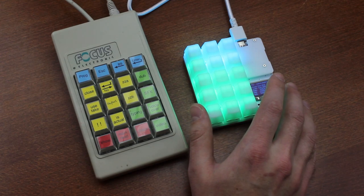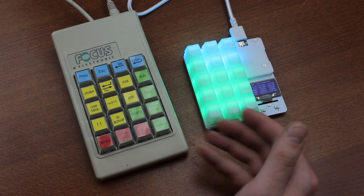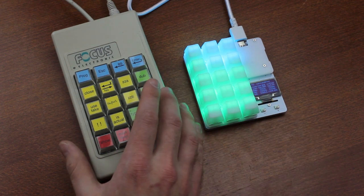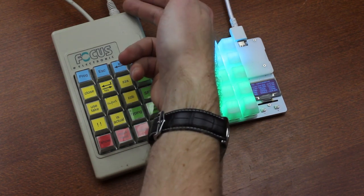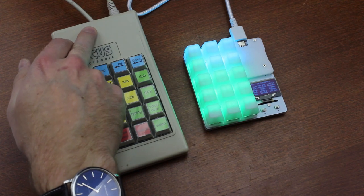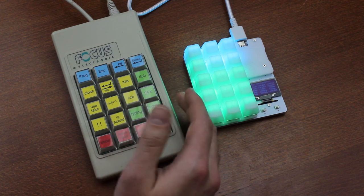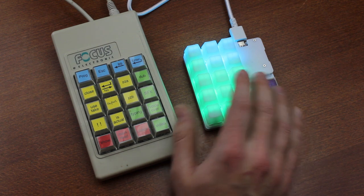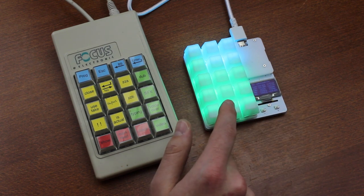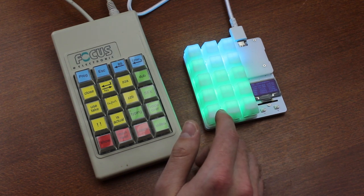On-the-fly recording is usually harder to arrange for macro pads anyway because they don't have the buttons you want to assign to the keys in the first place. The way old macro pads got around this was to provide a keyboard port — you'd plug the keyboard into the macro pad and then plug the pad into the computer, so the pad could record the inputs from the keyboard while still allowing normal typing. It would have been nice if this was a possibility, since on-the-fly recording beats any software-mediated approach, but the software and text file approaches work pretty well too.